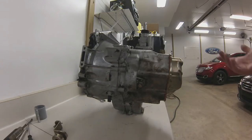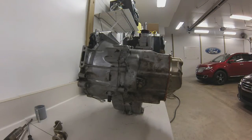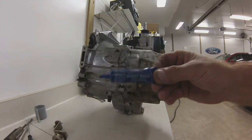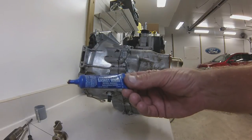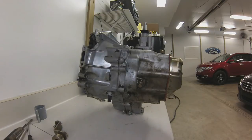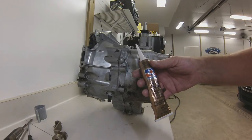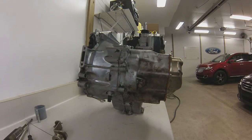The transmission is back together. A few things here: use your Permatex gasket eliminator or gasket maker. You also need a little RTV — use the Ultra Copper or Ultra Blue that's made for high temperature. Also the style of grease that's inside these units. Sealing everything back together.